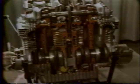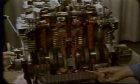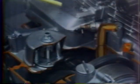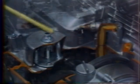This completes inspection of all the major components of the compression system and brings us to investigation of the lubrication system. The Z1 has a wet sump type engine and transmission lubrication system consisting of an oil pump, oil filter, oil breather, and their associated parts. Unlike the two-cycle crankcase, which is completely sealed so that primary compression can take place, the crankcase in the four-cycle engine is not sealed to the atmosphere.